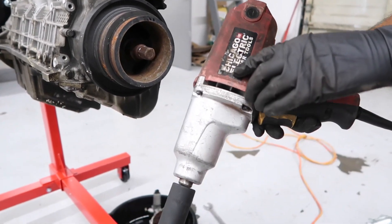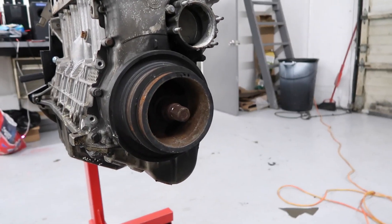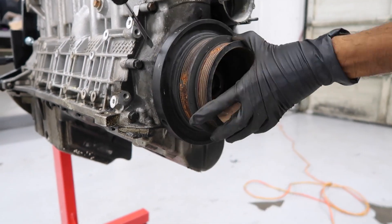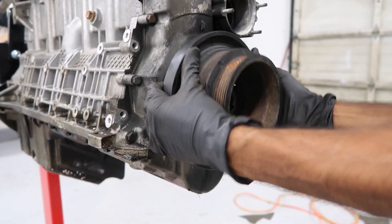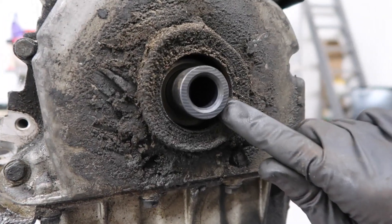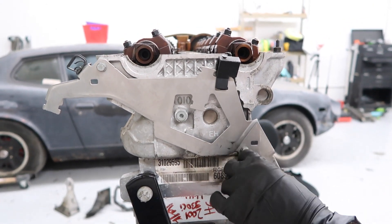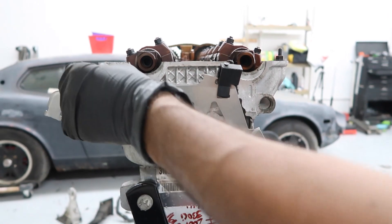The impact I used is a half-inch from Harbor Freight — I think it was about $60. It's an electric one you just plug in. I've actually used this one to remove the bolt off of a Range Rover as well, and it works really well for really tough, tight bolts. As you can see, the pulley just slides on with a groove — there's a groove on the crankshaft that it lines up with. Whenever you're putting it back on, make sure you align that groove otherwise it won't go on. This last bracket is held with 10mm bolts, and it's what you route the O2 sensors and some lines through.